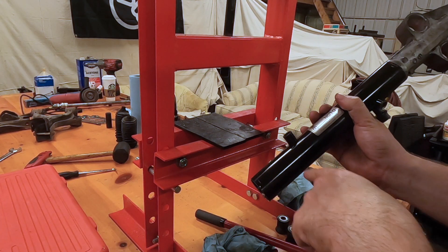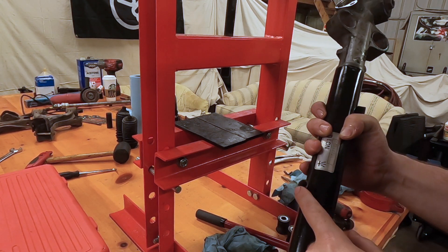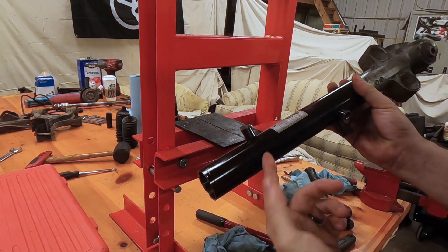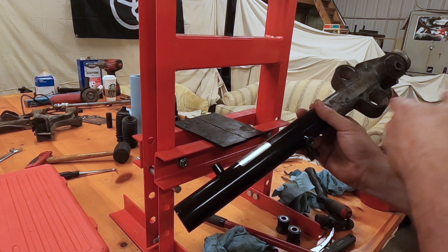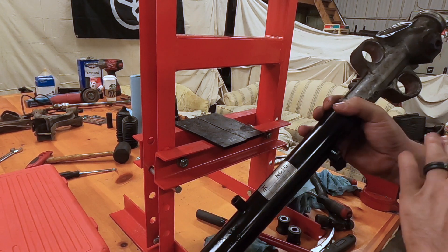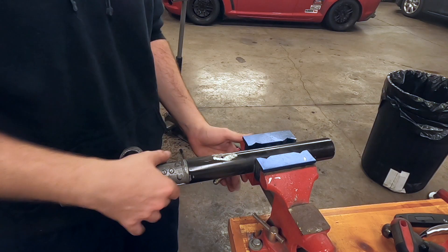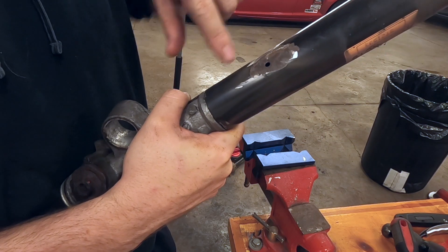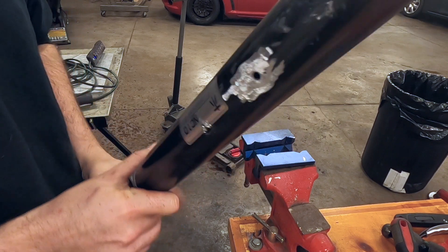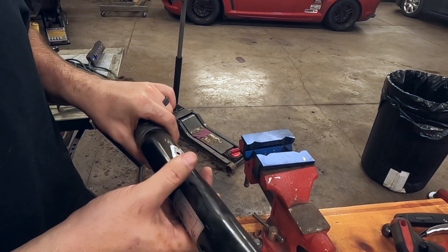There are two options here - two roads you can take. You can cut these off and weld this shut and grind it flat so it looks nice. Or, if you don't have a welder, take the bolts you took out, cut off a little bit extra of the line, and just hammer it over and thread it back in. That way no dirt can get in and no fluid will come out because there'll be no fluid in it - but you don't want dirt getting in and getting all inside the gears. Make sure you cap these two off. These are just useless gasket holders, so I'm going to cut them off, weld them shut, and then throw a coat of paint on this guy just to clean it all up. Once you get them cut off you're left with two holes, which I'm going to fill with a welder. This is just mild steel, so just a couple quick patch jobs. I've done this previously with JB Weld on both my rack and Dylan's rack and it works really well. For you K-Swap guys that want this to fit under the oil pan, this is the best way and what I'd highly recommend.